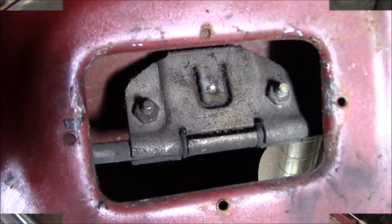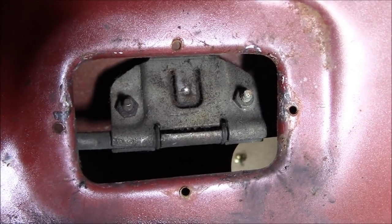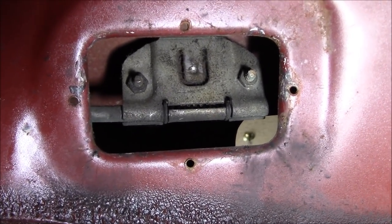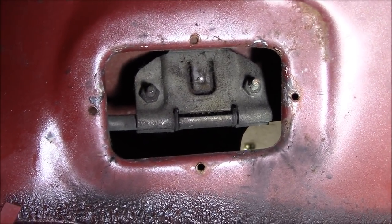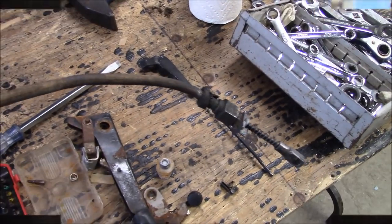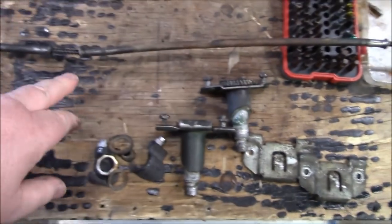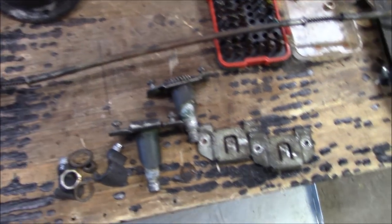Les is working on the wiper wheel boxes — there are little cover plates that cover the gear with two 3/8-inch nuts on the plate to be able to remove it. Les is disconnecting that and we'll move the plates to access the gear which controls the action of the wiper rack. The wiper rack is now out and it was quite a bit of a struggle — there's a bit of a kink in the rack around that area that was really preventing it from coming through the tubes cleanly.